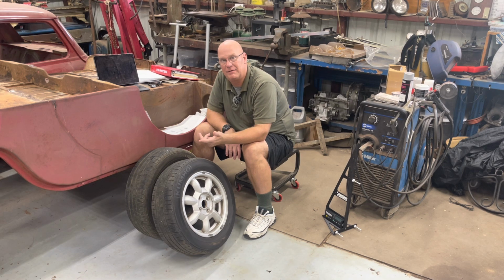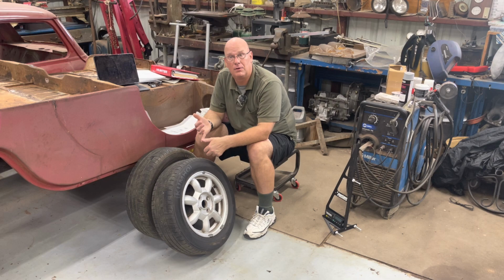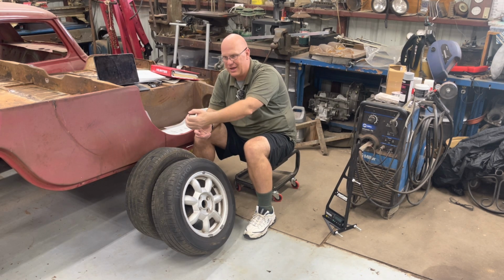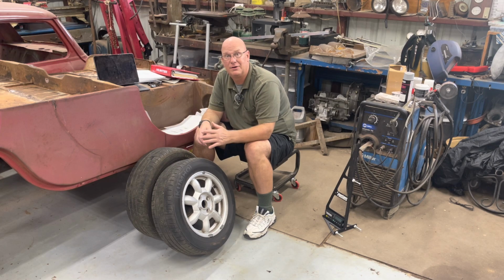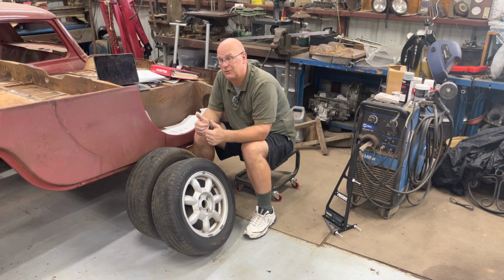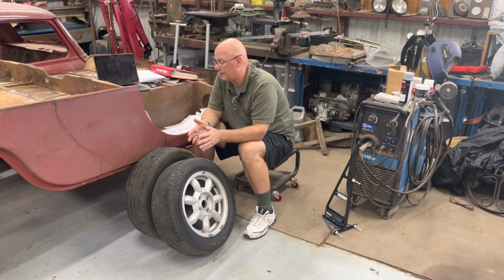I talked about eccentrics in one of my videos and how you adjust them. The Ford trucks, the F-150s especially, and the Expeditions, they had no adjustments available on the lower control arm. But you can buy a special tool where you pull the bolts out and put a cutter in there and twist it with a wrench, and it'll make a groove on the front and back mount for the lower control arm in the front. And then you can buy eccentric bolt kits that allow you to adjust your camber and caster on the Ford trucks. The Chevy trucks in the 90s had the exact same thing you had to do to the upper control arm. So if you have one of those vehicles, you can't make adjustments. You can, but you've got to spend some time and money doing it. There's still kits out there.